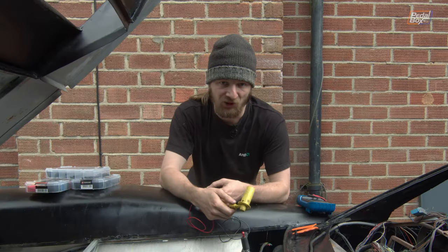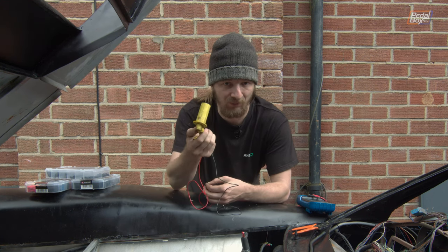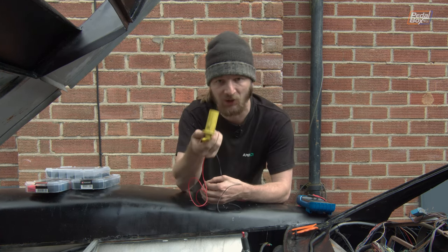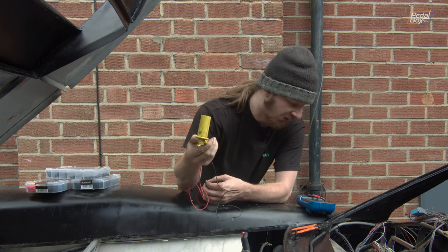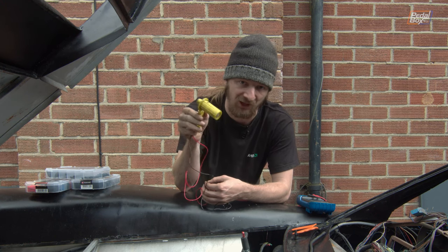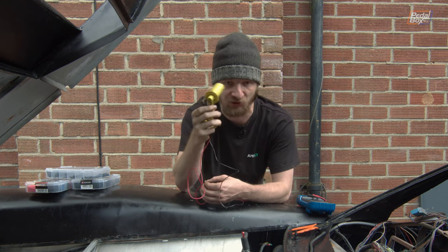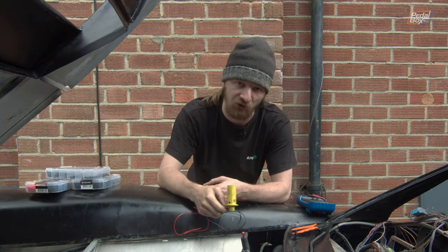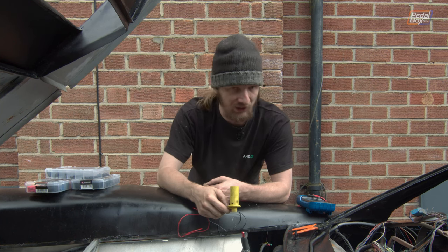Yep. And what's becoming a pattern for this episode, it turns out we did have the thing we need. This is the brake fluid level switch from an A3 of the same generation as the A3 and TT that we stole everything else from. So right now this is upside down, which means the float is in the top of it, so it thinks it's full. And I'm not sure if you can hear the beep from the voltmeter when it is beeping, but it isn't right now. Now if I flip it upside down, which represents no fluid, I get a beep, which means the circuit is closed, which is exactly the same behavior that we have on the level sensor that we're putting in here. So everything's going to be fine, this is all going to work the right way around, and we're not going to have a brake fluid warning light that turns off when we have no brakes.